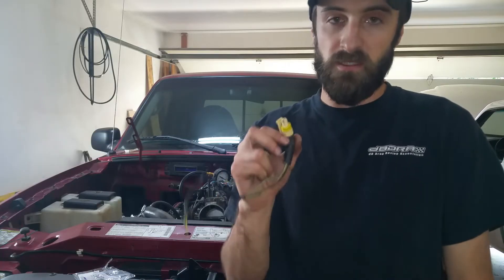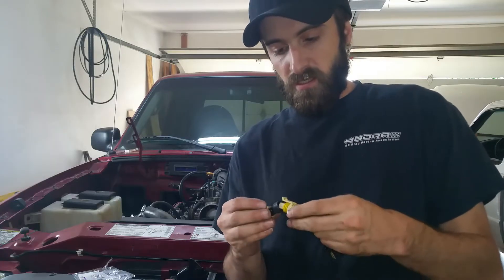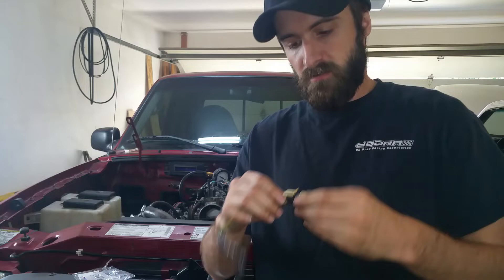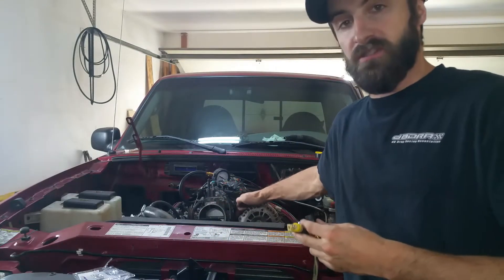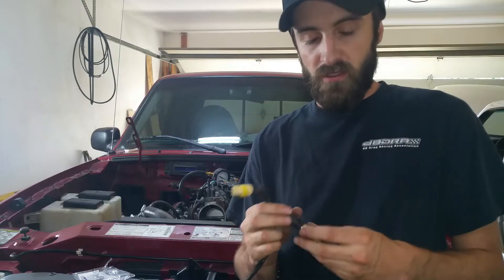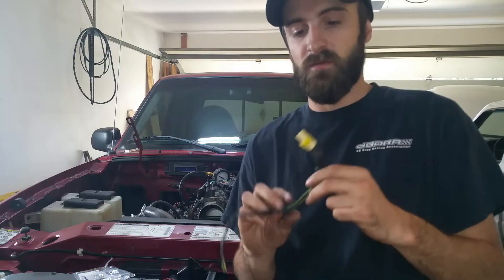I picked this up on eBay — it was $23. And here is the plug that I got; I actually got the plug from a junkyard. This is a plug from a mid-90s Buick Park Avenue, and it fits wonderfully — a little snug, but fits in there pretty nice. This plug is actually pretty common; it's also used for the throttle position sensor. So worst case, you can go to the junkyard and cut the plug from a throttle position sensor off, or just order one — they're like 10 or 15 bucks. When I was at the junkyard, I got this plug and brought it up to the counter a couple minutes before close and they gave it to me for free.